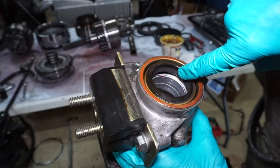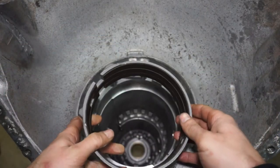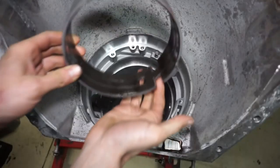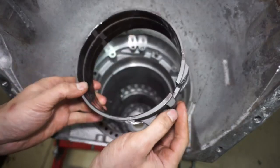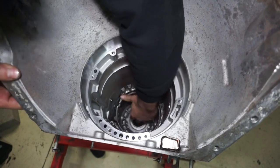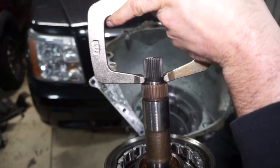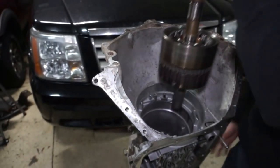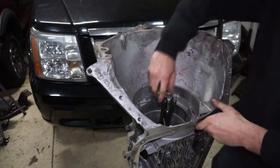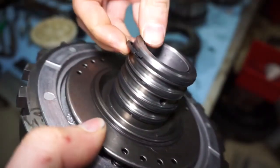If you don't have a driving tool like that, you can get creative — I've used a two and a half inch intercooler pipe before and that worked pretty well too. Next I'll repeat the same process for the tail housing bushing, rear seal, and then replace the rubber ring inside. For the reverse band, I am going to put this in before I drop the rear carrier assembly in. These two little dimples here get hooked right onto those two little posts that are sticking out. I took some fluid and rubbed it around on the material on the inside of the band. The best method I've found is to take a big vice grip clamp, clamp that little rib up there, and drop the whole thing in. The only real modification here is taking this second ring off — that's for part of the dual feed.